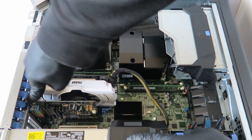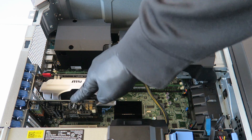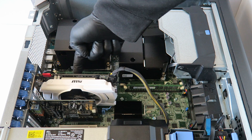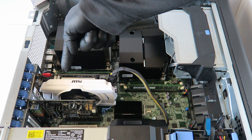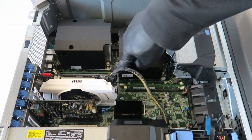I'm going to clip the sound card back into the secure clip for the PCI bracket. If you don't want to install it in the lower slot, you can install it in the top slot — there's another PCI Express slot up there. It's a PCI Express x16 slot but running at x4 speed. You can install the sound card there if you want.